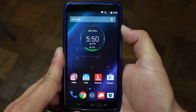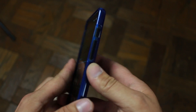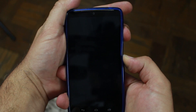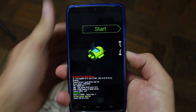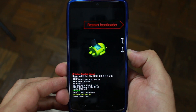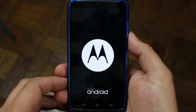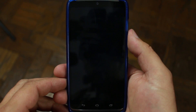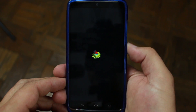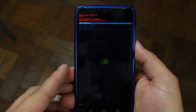To do this manually, turn off your phone and boot into stock Android recovery. Hold volume down then hold power - this boots you into bootloader mode. You can see it right there; scroll with volume down to Recovery Mode, hit power to select it. You'll see a 'no commands' splash screen - from there hold volume up then hit power to get your recovery commands.